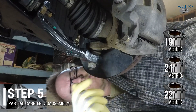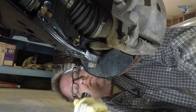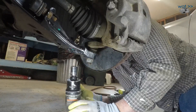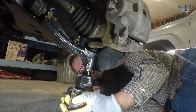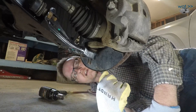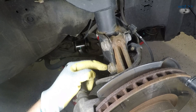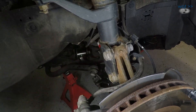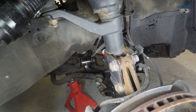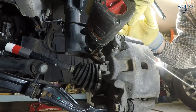Today this bottom ball joint bolt comes off with a 21 millimeter. The size and type of bolt will depend on the ball joint — this one's already been replaced once before. Since we're into using correct tools, let's try the air gun under here. This is technically not an impact-rated socket, but everything's easier with a good strong air wrench. This next step loosening the strut knuckle bolts tends to be bad for your alignment — once you loosen and re-tighten these, the knuckle's never in quite the same position. But it looks like I can just get my gun past the brakes here without having to remove them.